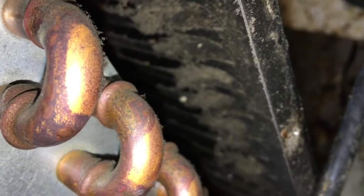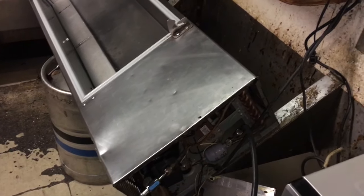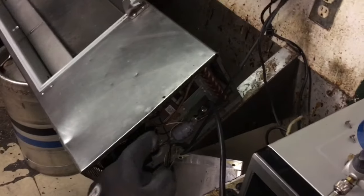The condenser looks clean, but I've got to get those louvers cleaned out too — a little bit of scuds there. So we're running. Suction pressure is going way down, either like it's low on charge or a restricted cap tube. I'm letting it equalize out.